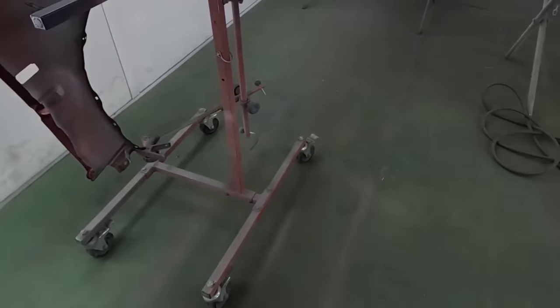And here's what it should look like. Completely flashed off, almost like a matte satin finish. This is a good indication that you are ready for the next coat. So if you didn't give it enough time and it doesn't look like this, give it a little bit more time. This is a long paint job, a lot of coats. Let's get rolling with that base coat right now.